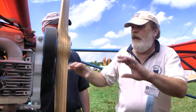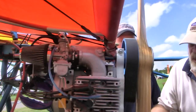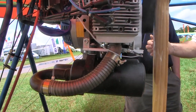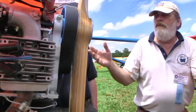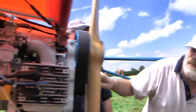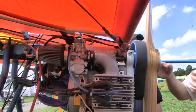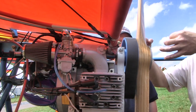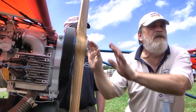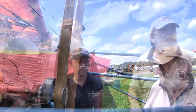By inverting the engine, the motor mount bolts are now on top and the exhaust is underneath. We made an exhaust that keeps it all out of the way, but there was no room for the motor mounts because the carburetors are up here. So Andy built this reinforced plate with two angles. The bearing mounts, which are usually to the side on a horizontal plane, are now on a vertical plane — but the engine still shakes the same direction and the mount still works just fine.